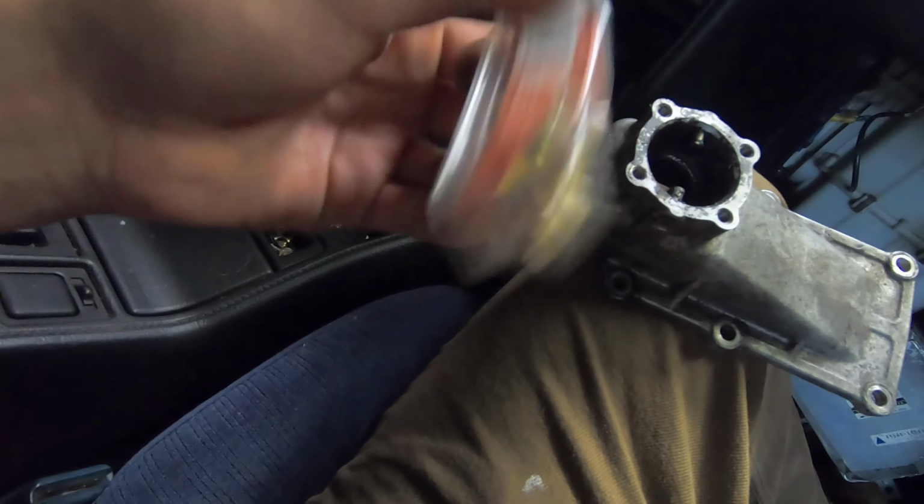All right, so just got to go grab some hardware, drop the transmission down a little bit, as you can see. Now I got some room to work, so I'm gonna throw it in what I'm assuming to be third gear here, push this lever forward, and slide this in, get it around. Falls right into place. I'm gonna bolt it down, get the shifting lever on, torque that down, and move on.